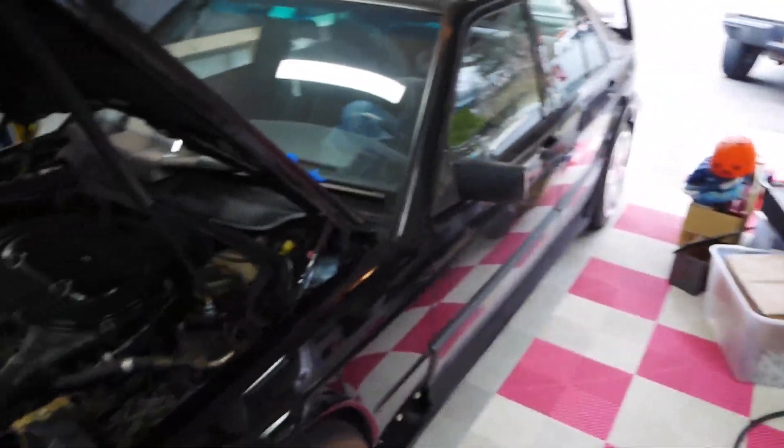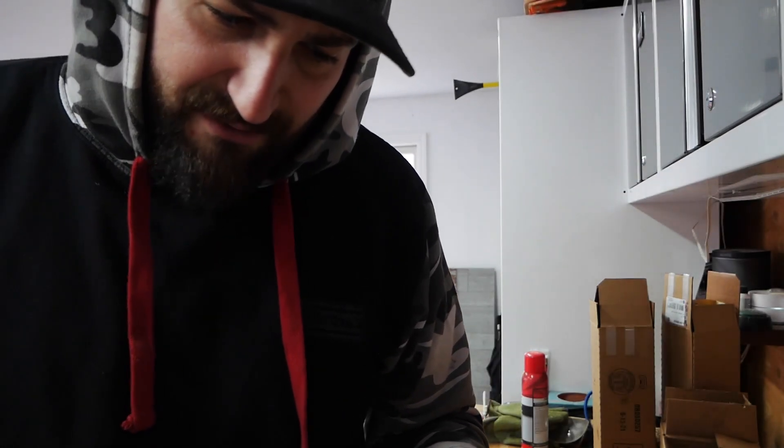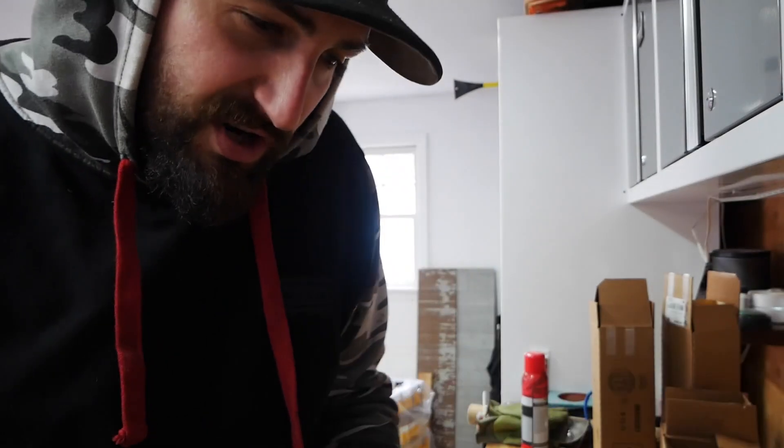I think the other flare is in the car and I might try to fiberglass that. But before we get into fiberglassing — one of the older videos asked for help about the turn signal situation. I found bulbs to try, from Parts Geek ordered through eBay — regular halogen bulbs — and they do not work. The blinkers still all blink when you go left or right, so that's not the problem.